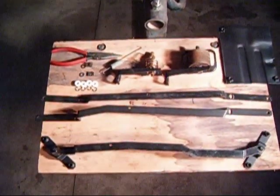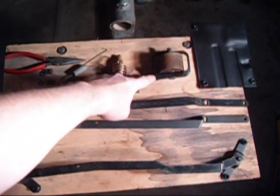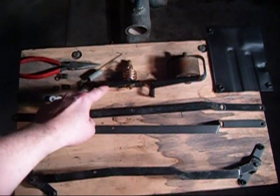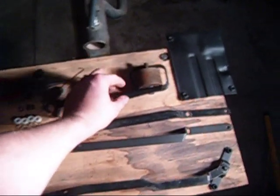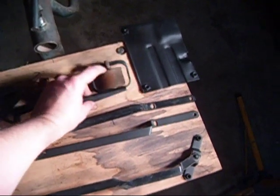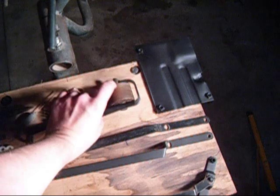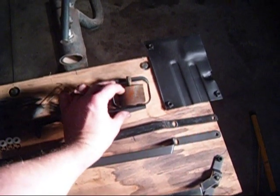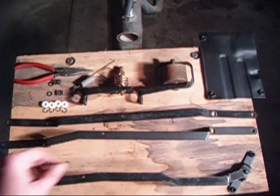Here are the different parts we're going to be talking about. You've got a German thermostat and bracket and a brand new VW Mexico thermostat and bracket. You can see the obvious differences. On the German one you should have about a quarter-inch gap between the thermostat and top of the bracket. Old ones that are no good will be fully expanded — you can test that by putting them in hot water.